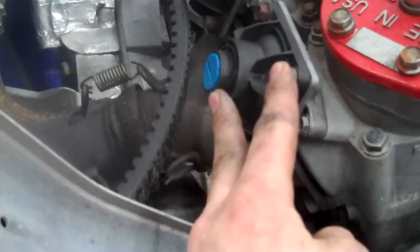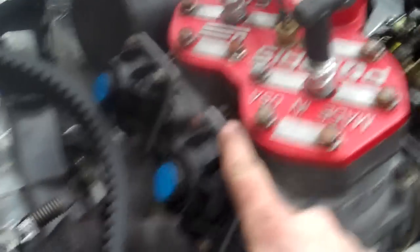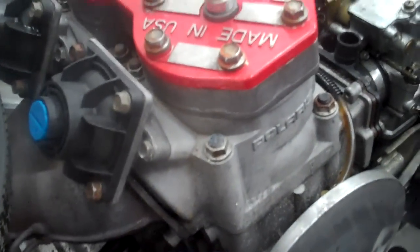I'd also take your power valves off. If your sled has power valves — whether it be a Skidoo, a Polaris, or a Yamaha — a lot of them have power valves. Take them off. You should probably be cleaning these every 1,000 miles anyway, depending on the kind of oil you're running, because they can certainly rob you of some performance.